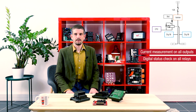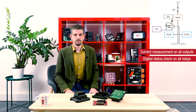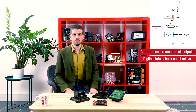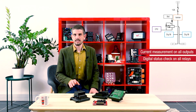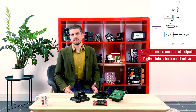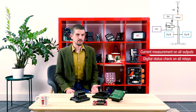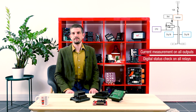For example, before relay activation, we can find out if there is already voltage on the output, which would prevent the system from being activated. In the same way, if both outputs are low, we can assume either a blown fuse or a missing relay. In all cases, the CAN box can report that the output activation is not possible. And if everything is okay, we can validate the switching status of the relay and detect a stuck relay. With the current measurement, you can also define the nominal current of the load and react through the software if we are not in range.